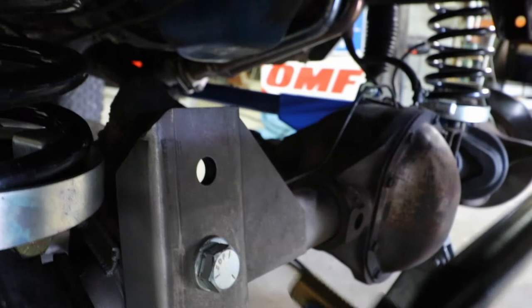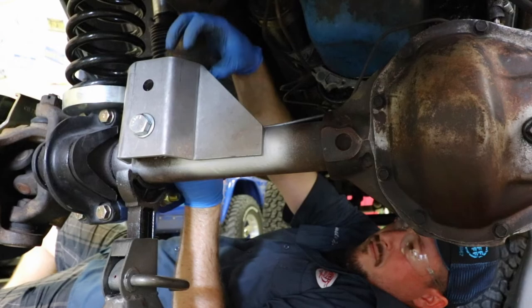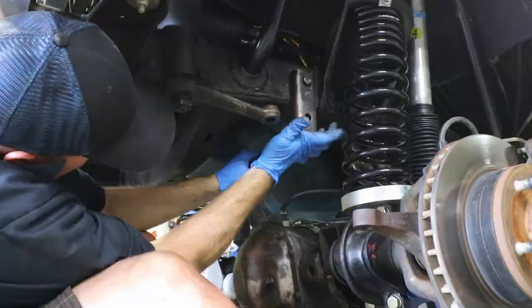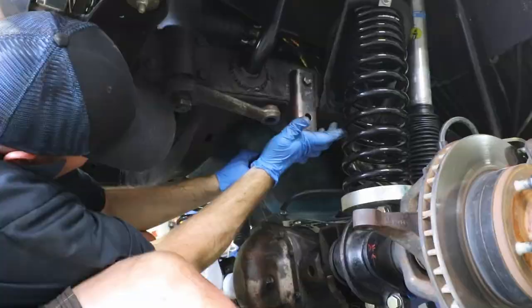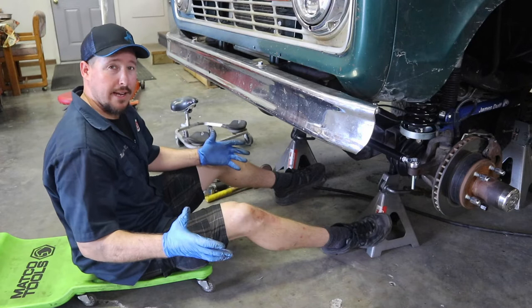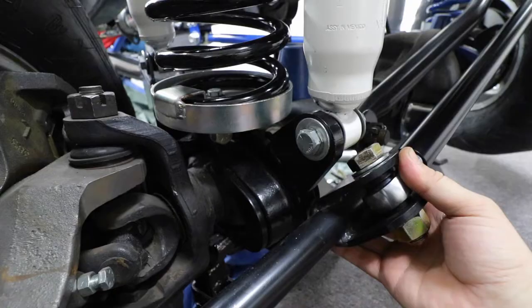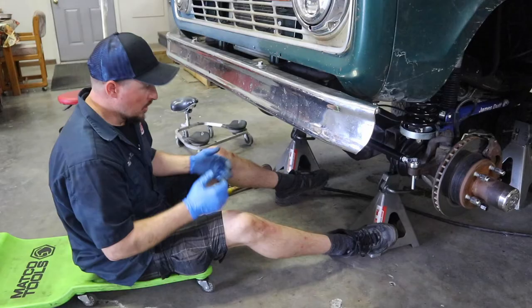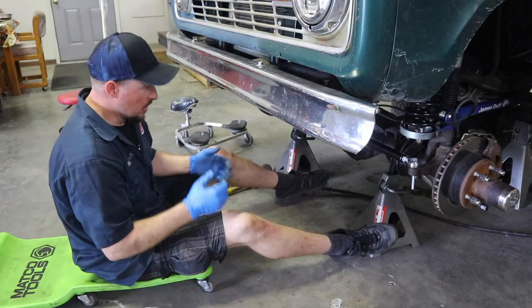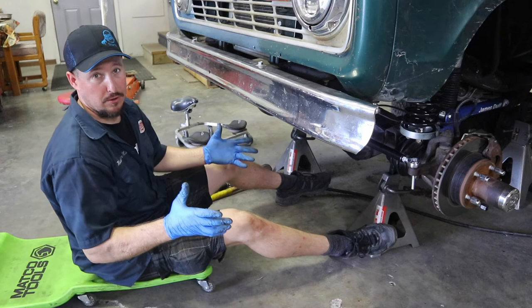We're about to do the mock-up of the track bar, and we just realized that the stock bump stop behind the riser bracket is in the way — this has to be removed before you can proceed. We've got the riser bracket in place and have bolted the track bar in, and we want to make sure it fits without any issue before we weld the riser in. We also need to put the steering system back in place and turn it lock to lock to check for clearance issues — at the C-cap if you have front-mounted shocks, at the dip, and make sure the saddle or junction point of your drag link and tie rod are not making contact with your new track bar mount on the axle.